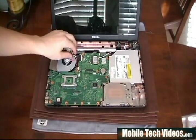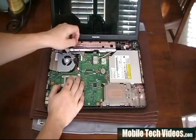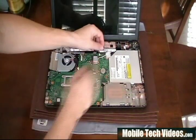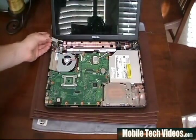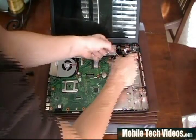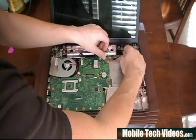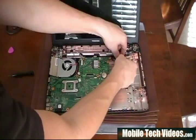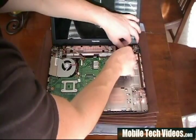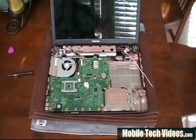Now that we've got the front panel off, we can talk about disconnecting some of the electricals involved with the monitor assembly. We're going to disconnect this one right here — it just simply pulls out. Trace this black one and pull it out of the beams. You can remove this small piece of tape and pull on it. Then we can disconnect our white wire by simply pulling it up and tracing it back over. There's a small piece of tape holding it here — pull that up and out of the way. Now all our wiring is out of the way and we can set it to the side.